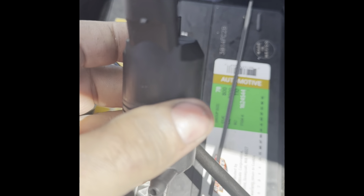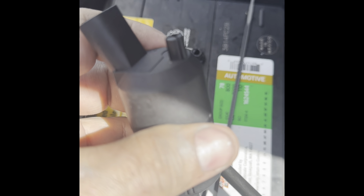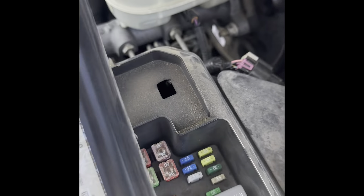These are relatively inexpensive — I think I got this for about eight bucks. You can also electrically check it. I've already checked my fuses and it's okay. If you look on your fuse panel, it'll have a windshield washer — labeled 'Wash.' This is an 06 Chevy, and you can see the windshield wash fuse is 15 ampere. You can also use a 12-volt tester to make sure you're getting power there. So anyway, I'm going to get this replaced and hopefully have that working again.